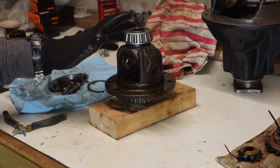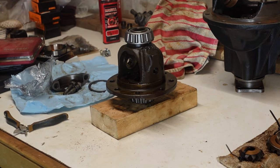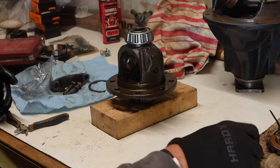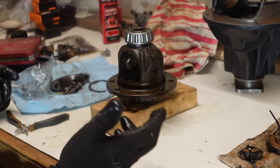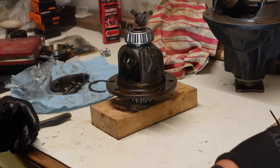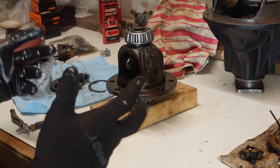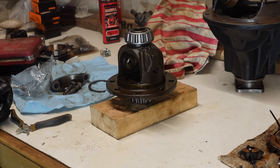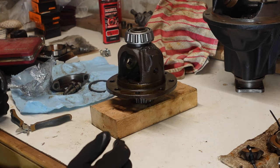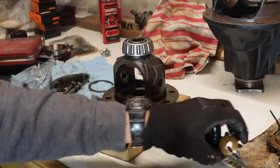The next big thing I need to do is measure backlash and then get the carrier all set up with the pinion, but obviously I've got to put the gears on the inside. The workshop manual is pretty non-specific on this. When I took this all apart, I had shims everywhere and I kept them all together. All I'm going to do is essentially put it back together. These shims are all the same thickness, so I don't think it really matters — left, right, top, bottom. The workshop manual says to shim as necessary to reduce the end float to give minimum backlash consistent with freedom of rotation. Not a quantitative measurement, just a qualitative one. So we'll go ahead, put it back together, and check the backlash. I'm just going to go by feel — didn't feel bad when I took it apart.